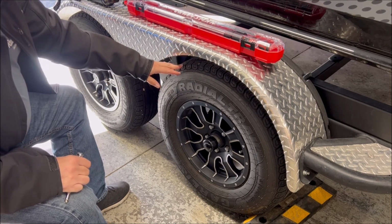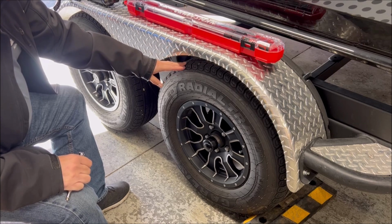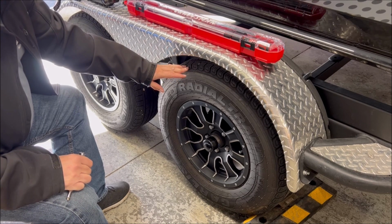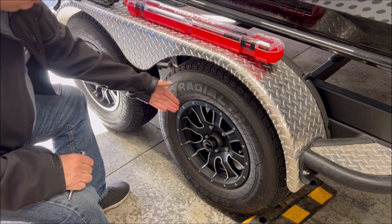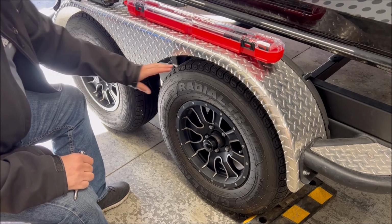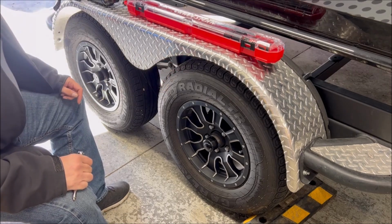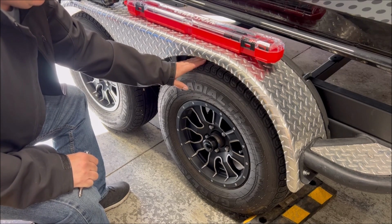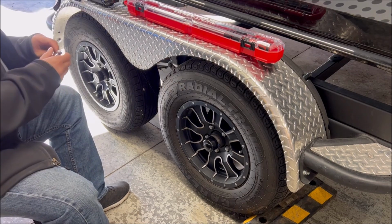When you drive down the road with your tow vehicle, towing your trailer, your tires will heat up a little bit. Some road friction, making turns. You've got trailer brakes. This one's got a surge brake on, looks like this axle here. It'll warm up a few degrees, right? So that's normal. That's built into the equation, right? I should have this filled up to roughly 50 pounds in my case.